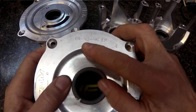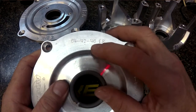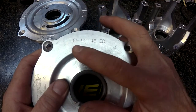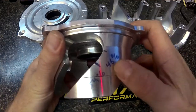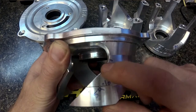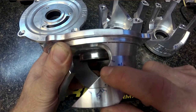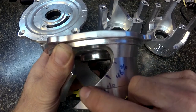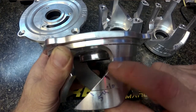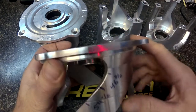The second angle is your high gear. The 46 on this particular one means 46% of your time is in low gear until you hit high gear — so 46% low gear, 54% high gear. When the roller is in this portion, this is your low gear; as it's climbing up you'll have a faster shift because it's a steeper angle, then a little slower shift. When it comes time to backshift, it'll backshift to here really fast, but it won't necessarily want to climb back to the lower area. When you're going slower you have a little excess torque, so you can handle that.